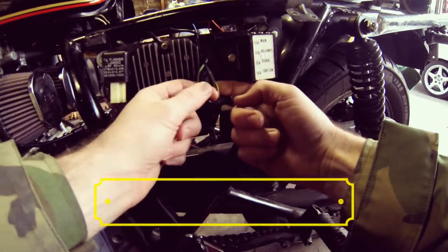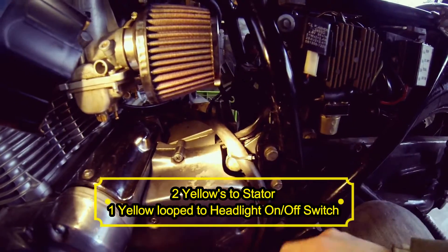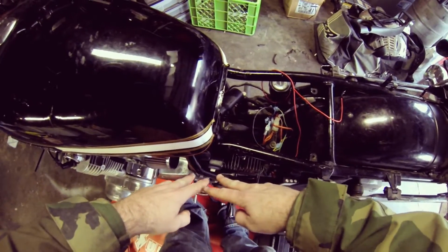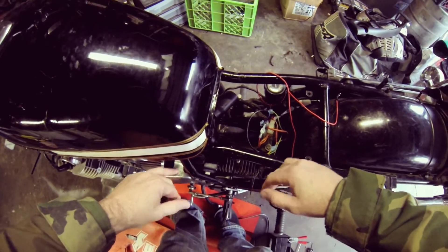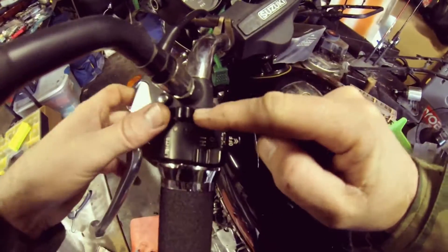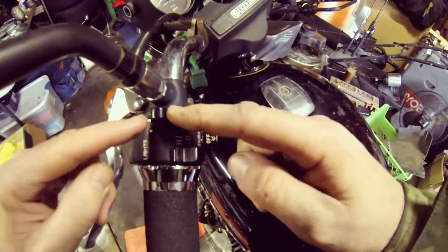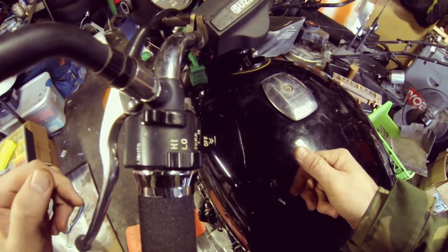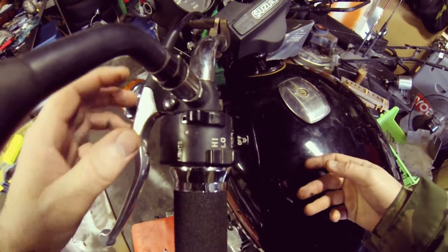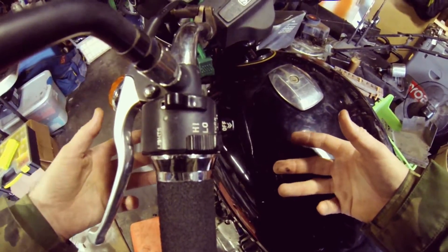There are also three yellow wires — three wires that come out of the engine in this little pack here, one wire for each coil. Two of them connect to the regulator and one yellow wire runs all the way up to a switch. Each yellow wire is connected to a coil. If this shuts off one of the coils, it tells the bike that it does not need all three coils to charge the battery.